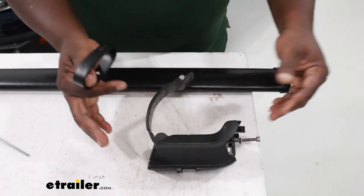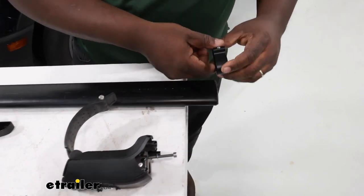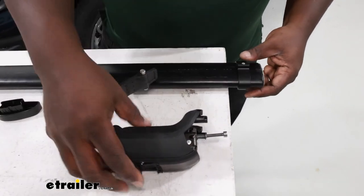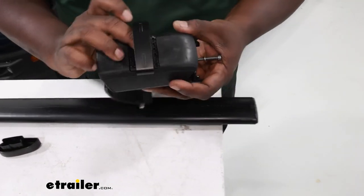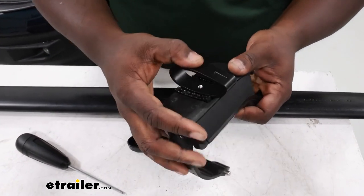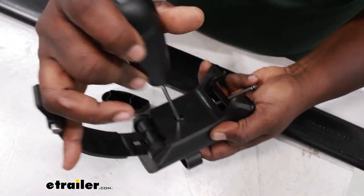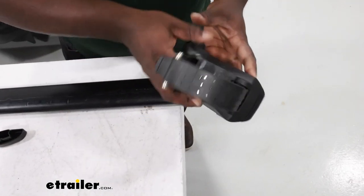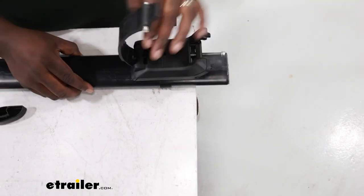When you flip over your bar, it makes it a little difficult to find the orientation, so I've found if you just take off your end cap and slide your adapter over — making sure the fatter side is going towards the front — you can make sure you're aligning it correctly where you have the access for your Timberline Tower on the outside. From there, you're just going to drop it into your cradle and thread it in a little bit using your Yakima tool. You don't want to go too tight because this is how it actually secures to the bar. And then with the opening to the outside, we're going to slide it down to our pre-measured position.